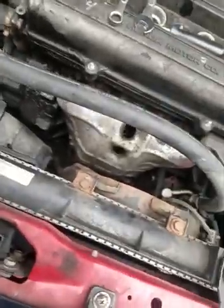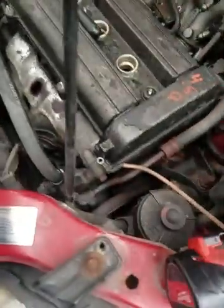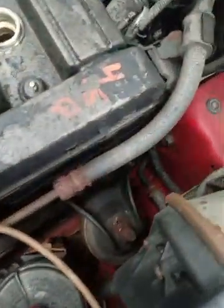As you can see, I just got to get these bolts down here on the intake and pull the intake back — I'm just going to pull it back and kind of push it out of the way. I'm going to try to do the same with this exhaust down here, just try and push it back, just not to wiggle the head off. I haven't gotten any of these belts off yet or the timing or anything, but I'll get to that when I feel like jacking up the motor.